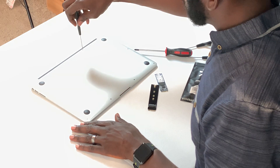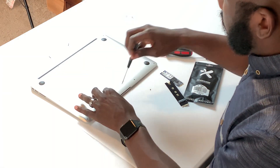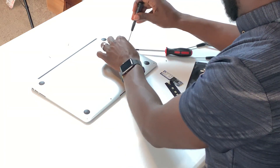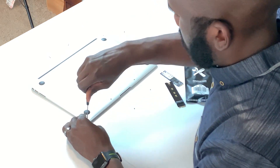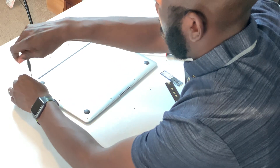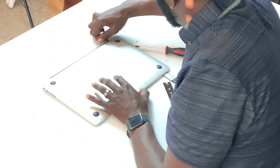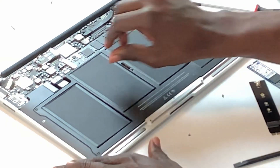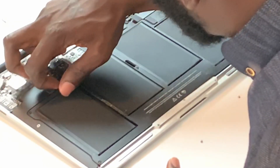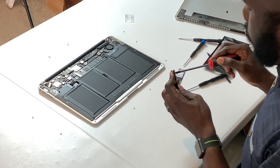The first thing we're going to do is pick out all the screws from the bottom. Then the first thing we want to do is disconnect the battery — just grab this tab and pull that up. Battery is now disconnected. So let's go ahead and get this new drive put into the bracket.